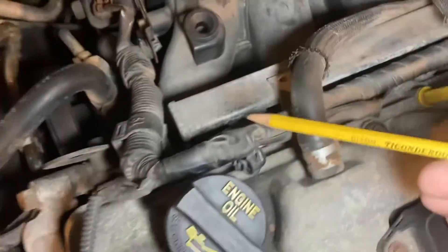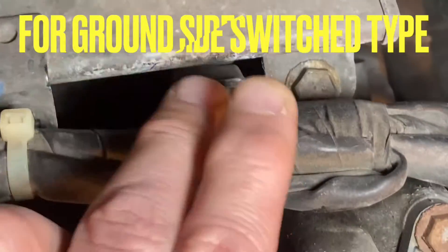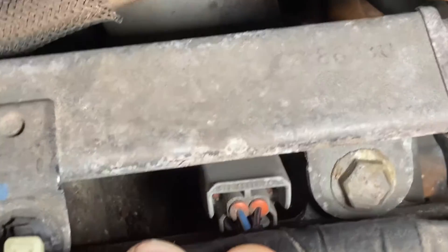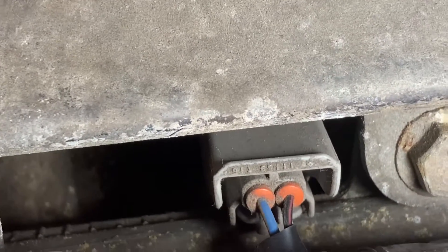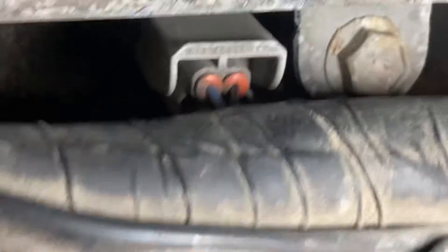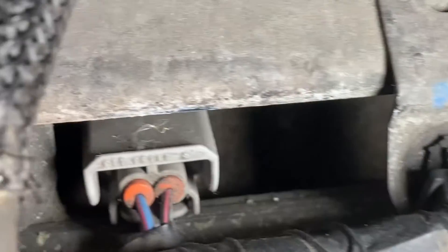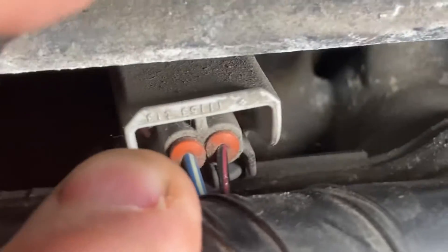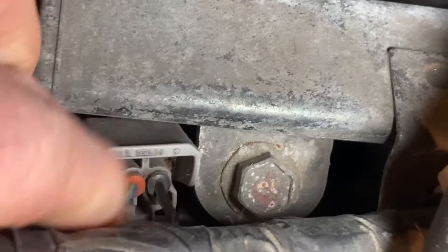So let's take a look at the fuel injector rail on my car. Most cars are going to be laid out in a very similar fashion wiring-wise. So what do you actually have on an injector? You'll have a 12-volt battery feed, and you'll have an intermittently switched-to-ground control line. So what you want to do is look to see what is the common. There's a black with a red tracer, blue with a cyan tracer, black with a red tracer, blue with a red tracer — looking at cylinders 4 and 3, you can tell that the black with the red tracer is the common line. Clearly this is the 12-volt feed because it's common to all four. Make sense? And these are uniquely switched to ground.